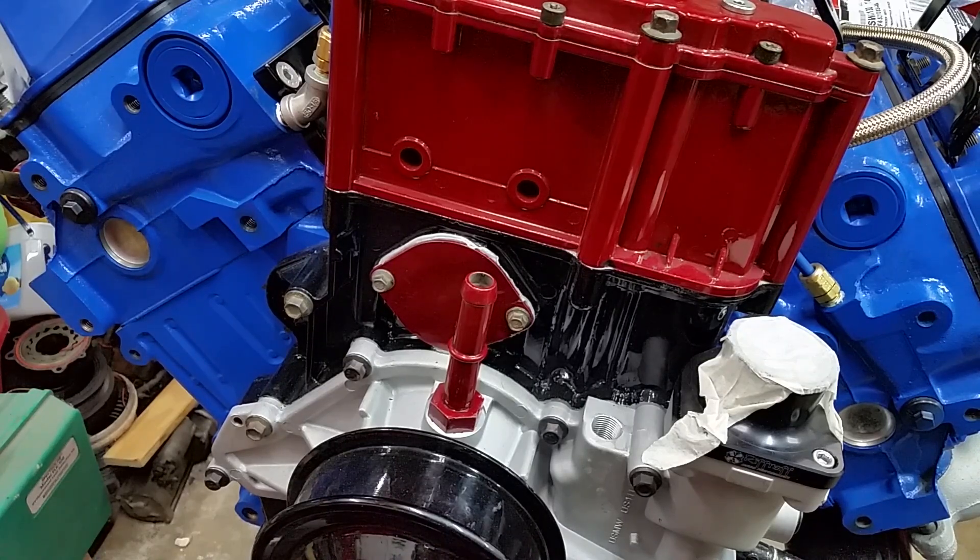So we've got all our sensors. Let's put them in. They're all 3/8 pipe thread, torqued to 27 foot-pounds. I doubt we'll make it that far because we want to put them where you can get the clips on. You don't want the clips facing somewhere that won't work. But we get them tight enough so they won't leak.